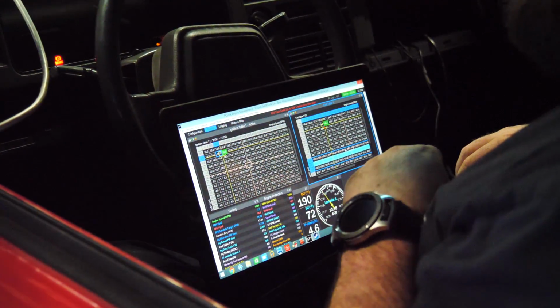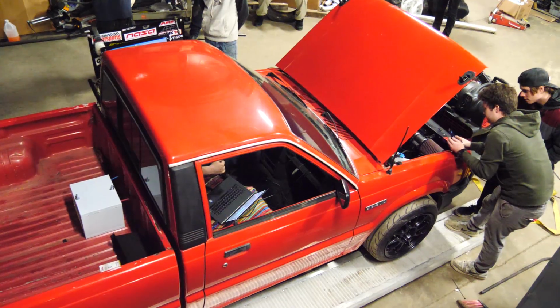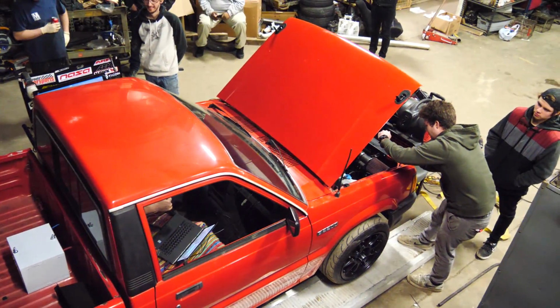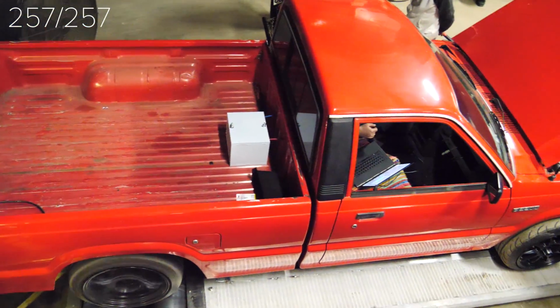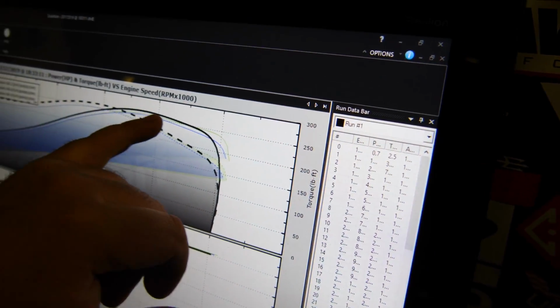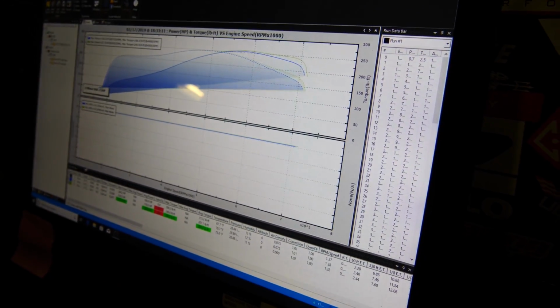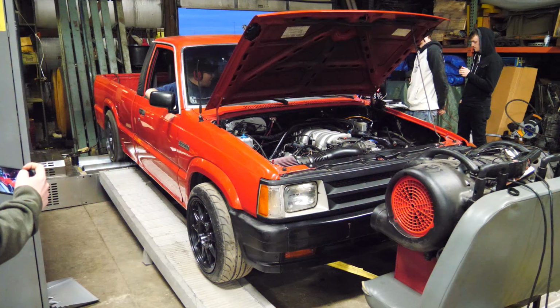This is for the viewers. Now we're gonna mess with timing and be able to adjust that. Alright. Now we're just getting the fueling right. 3 more horsepower with some fuel adjustments. Just right here where it's a little bit too rich. Pretty good power curve. It drops off a little bit towards the top, but not much. That's why I held out longer here, because we fixed the fuel.